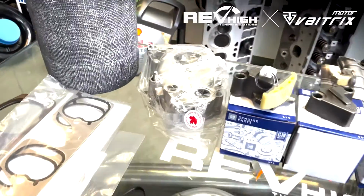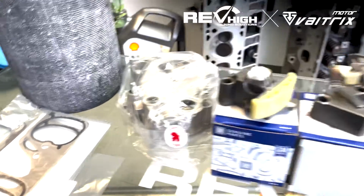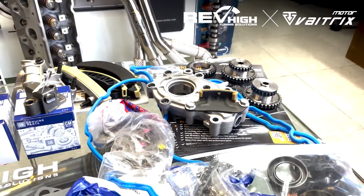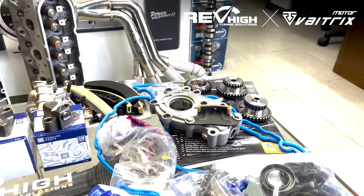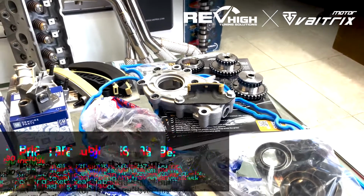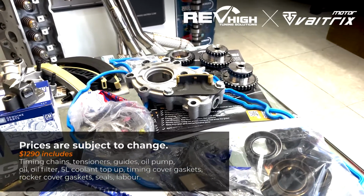As far as the oil pumps, we have a genuine GM option made in Canada. We also have an aftermarket option, which we use all the time. Awesome quality from America. We've got the 3 gears there too, the crank and the 2 idlers. We find 50% of the cars we do need them. It's not a bad idea to do them anyway.